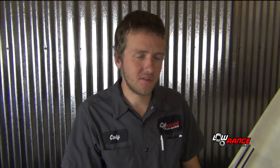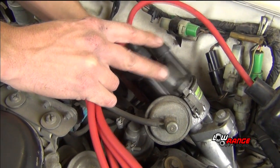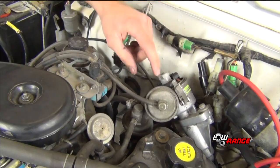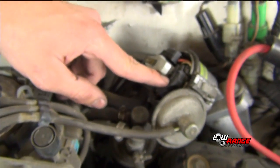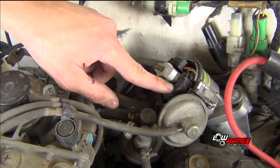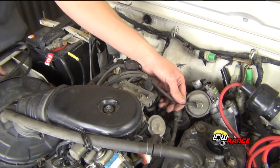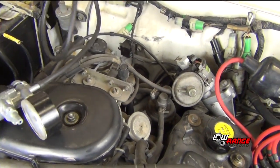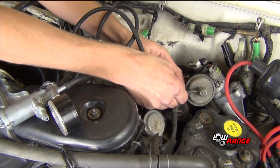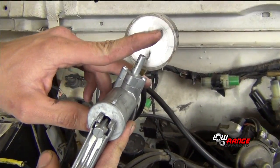Today we are working on a 1987 Suzuki Samurai. We're first going to start off by removing the distributor cap by popping the two clips on either side and moving it out of the way. This guy on the side is the vacuum advanced controller, and right behind it is the igniter. We want to make sure that when you apply vacuum it moves 3/8 of an inch. We're going to start by removing the vacuum hose off the side and then attaching the hose from your pump onto the vacuum advanced controller on the distributor.